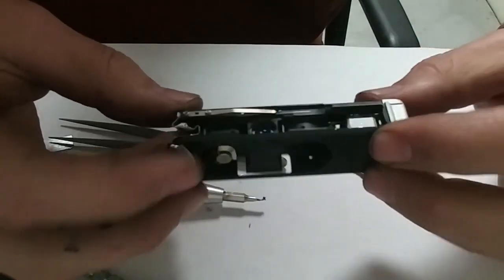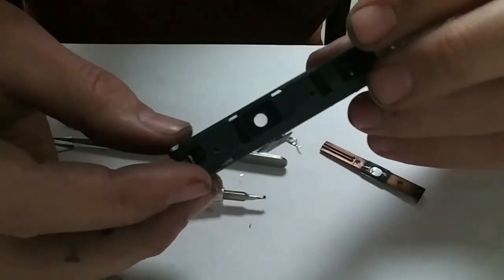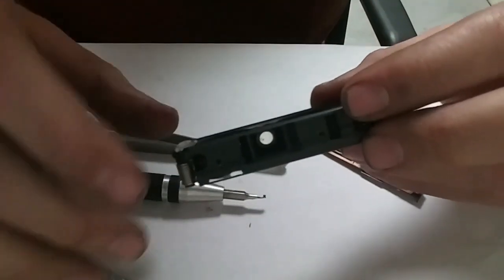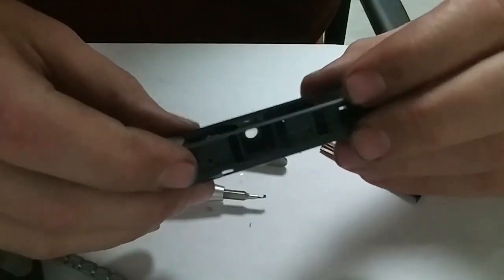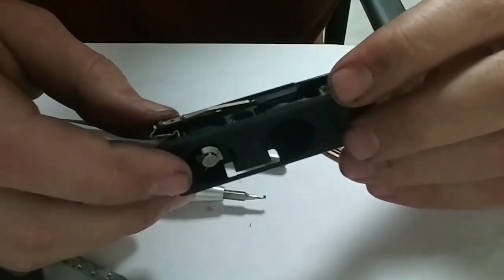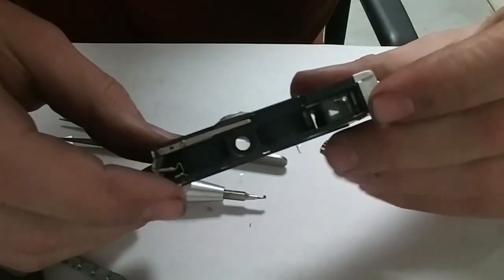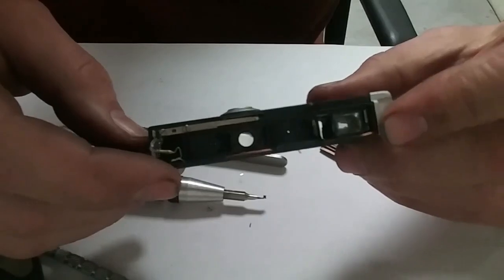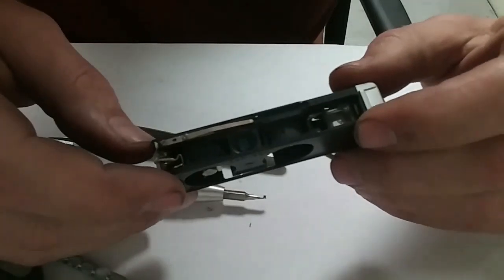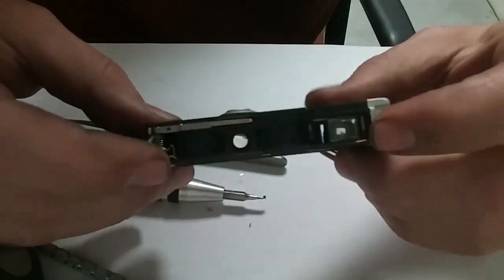So there's your lens — or at least the front of it. The back end is right there at the back of the film cassette. The first time I did this was purely to clean the lens, but the only way to do it is to tear the entire thing apart, which I did much more successfully — or at least much more smoothly. I'm still not real happy with the sharpness of the photos, but I'm using old film from a trip I took to Europe in 2003, and the film was old then. So I'm pretty much burning through what I've got to get some fresh film.